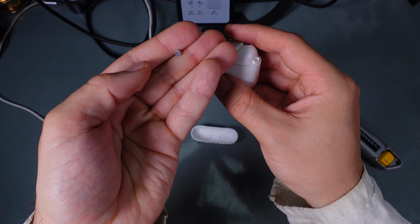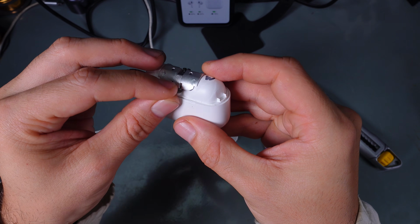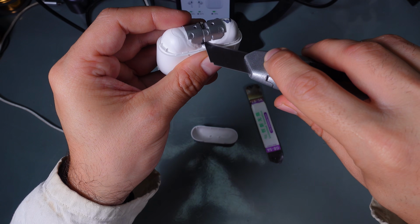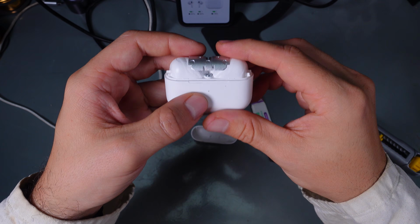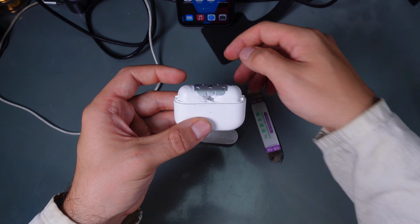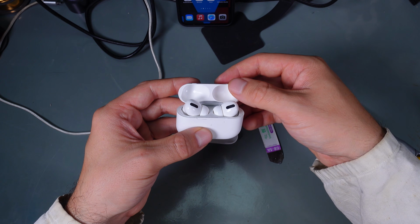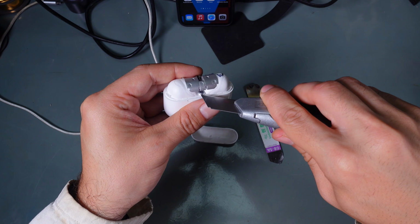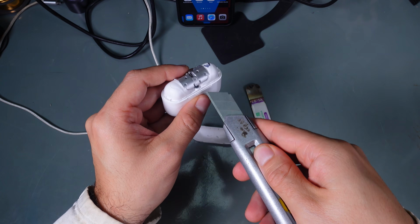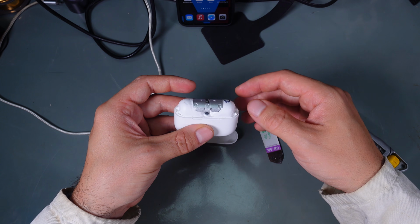We've got the magnet by itself that popped out from that location, and the idea is that you need to stuff it back inside, and you have to do it with the correct pole, because if you do not have the correct pole, it will not respond. So let me try to open it and see if we get it right. As you can see, we do not get any pop-up, and that's because I put it the opposite way. So let me try to correct that. Maybe that's going to be the correct way. Let me try to open it, and as you can see, it's working.